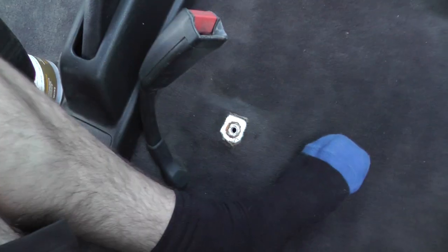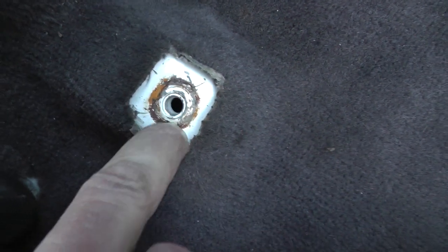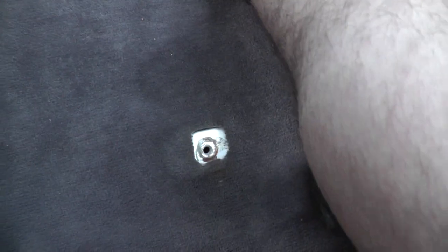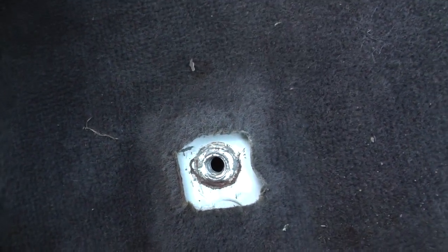And now, finally, I can just put the two seats back in. And that's just obviously just by these posts. There, there. And someone said, on one of the Facebook forums for the CRX, it's a really good point, that these fail here. So you should check these haven't corroded completely. These don't look in maybe amazing condition, but the pictures I saw, it was all rusted out. It looked like the actual thing was going to fall out. So that's one, that's the other one. It's these rear posts. So when you do take seats out, make sure you have a look at these and just check they're not completely knackered, because apparently they fail and you don't really want that.